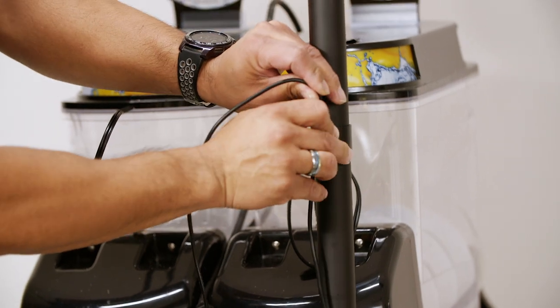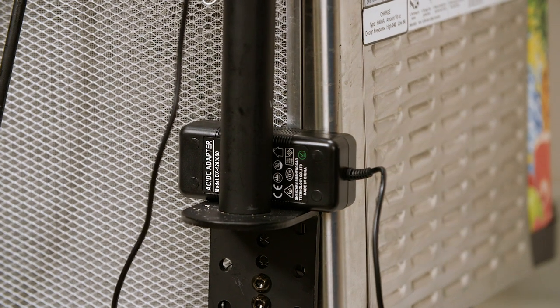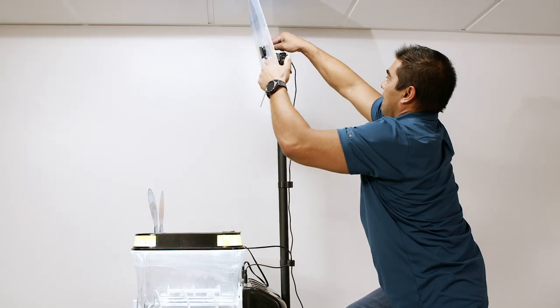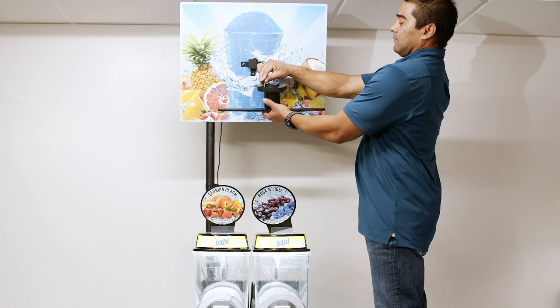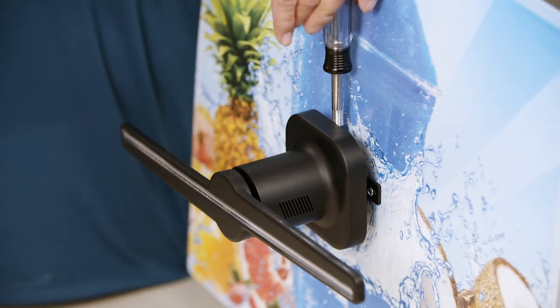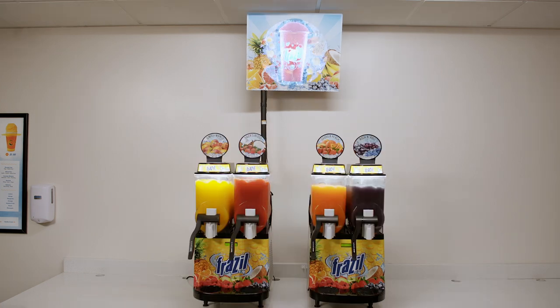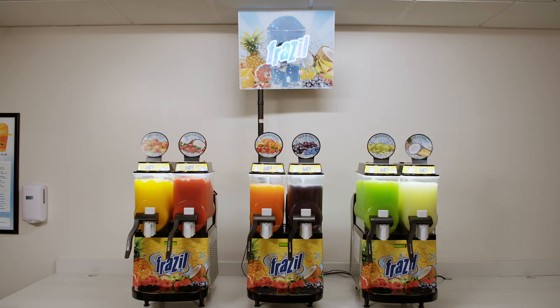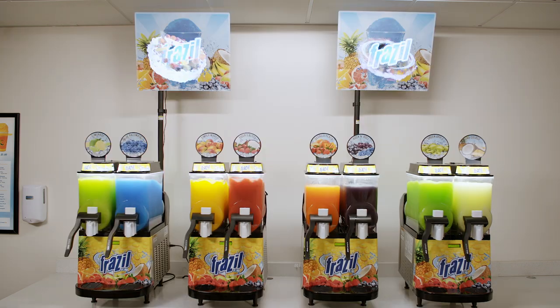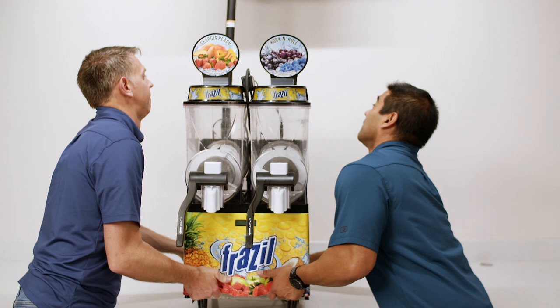Step six: install the hologram display. Feed the cord through the wire clips. The fan's electric cord should be placed at the back of the mounting pole so it is less visible. The electric cord power adapter should rest in between the machine and the clamp brace — this way it is kept off the counter to avoid damage in the event of a spill or leak from the machine, and to keep it out of the way for cleaning. Thread the power cord over the top of the VESA plate and through the hanging sign on the swivel arm assembly. Plug the power into the back of the hologram display. Slide the hologram display onto the mounting bracket on the swivel arm assembly. Secure the hologram display by tightening the screw between the mounting bracket and hologram display using a screwdriver. For a single machine, the center point of the fan should be within half an inch of the center point of the two bowls. If a store has two machines, the center point of the fan should be directly in between the two machines. If the store has three machines, the fan should be centered between the two bowls on the machine in the middle. And if the store has four machines, the fan should be centered between the two inside machines. If the machine was lowered or moved from the counter for assembly, carefully replace the machine onto the counter.